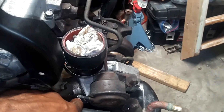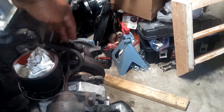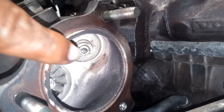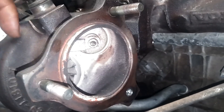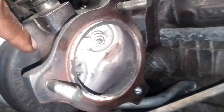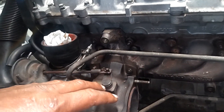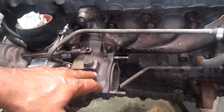When the valve opens, it activates pressure on your wastegate actuator. The wastegate actuator starts to extend its arm out, which opens up the wastegate inside. That wastegate opens up and bleeds air off the turbo turbine, which slows the turbo down and allows exhaust to bypass the turbine.